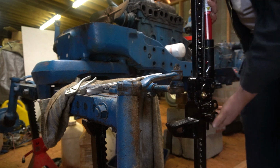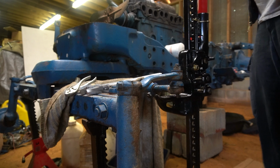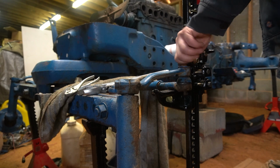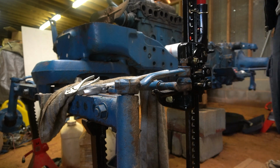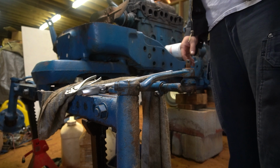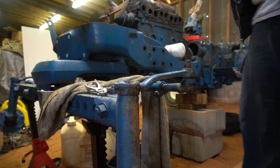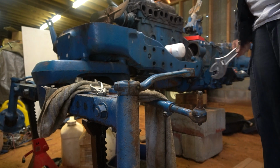Now there is a grease zerk down here, so I can't go right under the joint. And I don't want to lift the tractor, just try to put a little bit of upward pressure on it. And that worked. That's all it took. And as you see, my jack stand still has the weight of the tractor. There's a chance that as loose as that was, I will not have to use a pickle fork on this. I'll use the crescent hammer. It just fell right out.